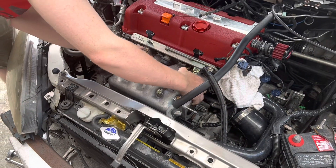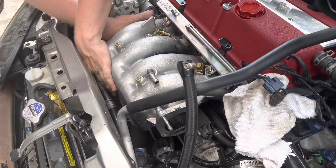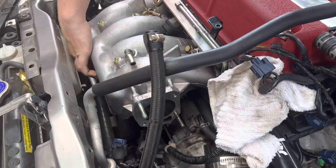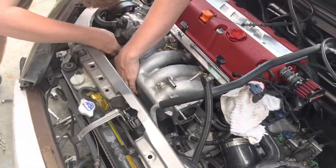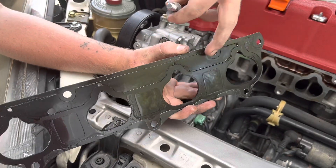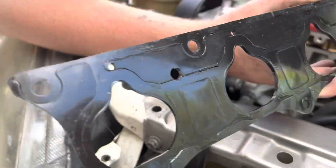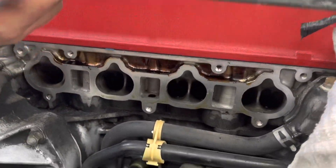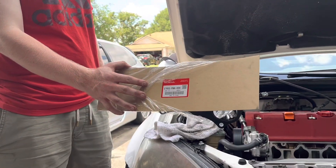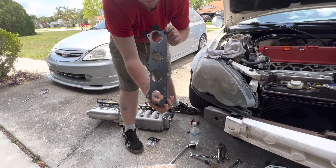Getting the last bolt out on the old manifold. There were some gas line difficulties — the gas line was off and I hadn't been paying attention for the last 10 minutes. Taking the last bolt out now. I've seen pictures of people with gasket material going into their runners, but I hadn't had it on long enough for anything bad to happen. This was just a little Hybrid Racing thermal gasket; we'll be putting the OEM one on. It's pretty clean in there. OEM gasket part number right here — that's what you're gonna need.